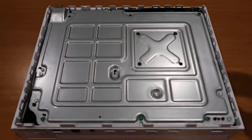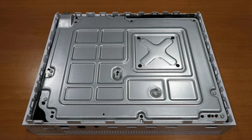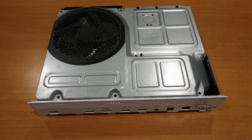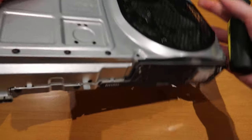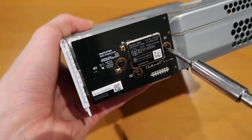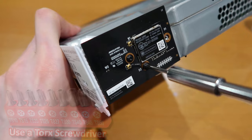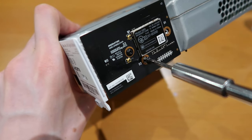There are about six green screws in total, so I'm going to speed this up. Once you've taken all of the green screws out, flip your Xbox over and carefully bend the plastic just a bit to pull the lid off — just wiggle it from side to side and it should come off. Now your Xbox is going to be looking open inside. Pick it up, go to the sides, and you'll see little motherboards clipped on. One of them is the Wi-Fi chip. These screws are not Phillips head — they are actually Torx head screws. If you've got one of those screw kits you should be fine; most security-style tool kits have the right screwdrivers.